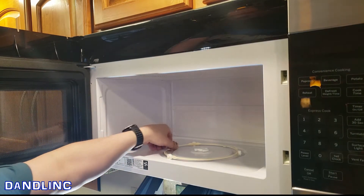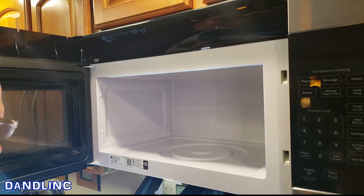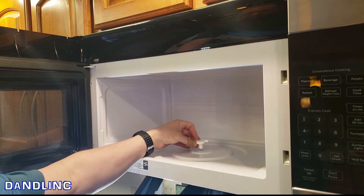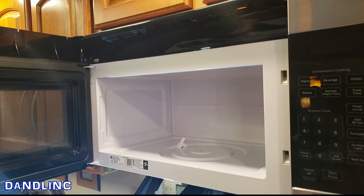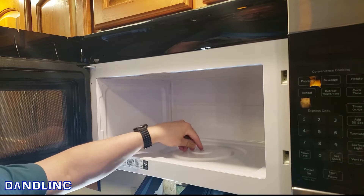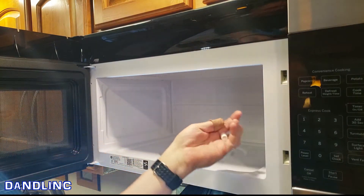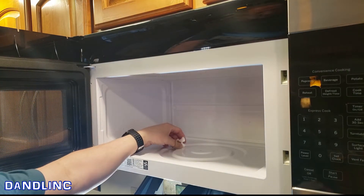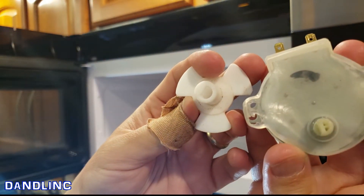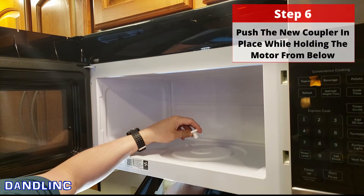Okay, let's put this in. Here's the old broken piece. You may ask yourself why you had to take the bottom piece off just to get this in — well, there's really no way to pull that broken piece off otherwise. The axle piece was down on the bottom, pushed out of the coupler, which is fairly tight by design, so I had to take it apart to pull the broken piece off. The new coupler can only fit on one way — it's got that half-moon cutout — and on the top piece I'm going to push down while holding the bottom piece in place.